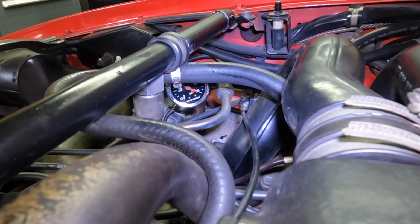So it's at about, I don't know, 40 psi or so. And when I shut it off, it's supposed to hover around 1.5 bar, which is a little over 20 psi, and just stay there for about 20 minutes. However, see, it's going to drop to 20. And then just continue to drop. And there lies the problem.